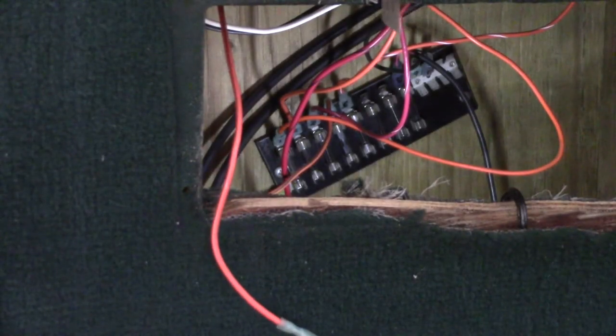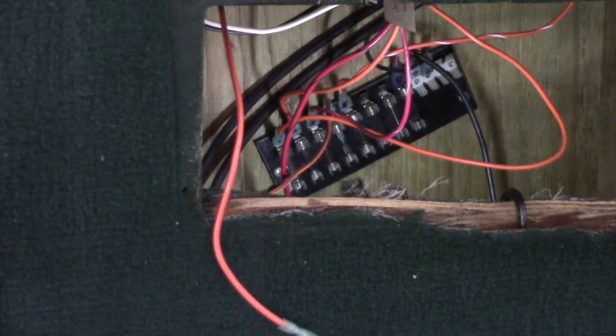And we're in. I've already found — with the meter set on DC — we've got 13.97 volts, which is good. So that guy is good to go. Unfortunately, over here we've got nothing. So chances are pretty good that fuse there is blown. I've got to get something to get that fuse out — it's one of those old-style glass ones. I just got to be careful not to break it, although I've never broken one. Let's try a pair of pliers and see what happens.